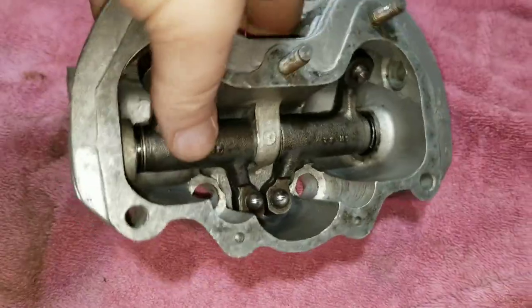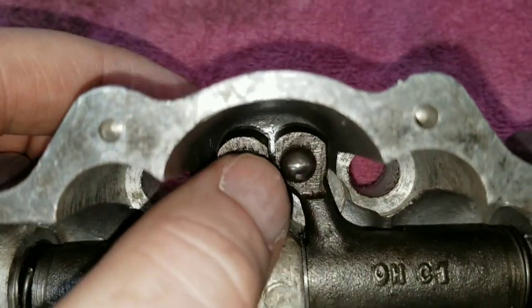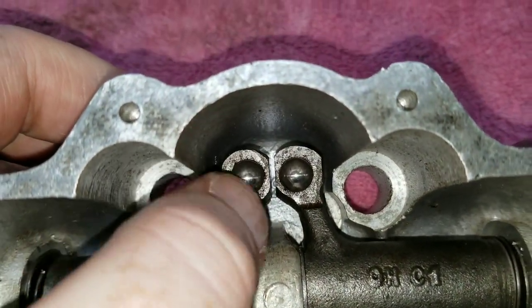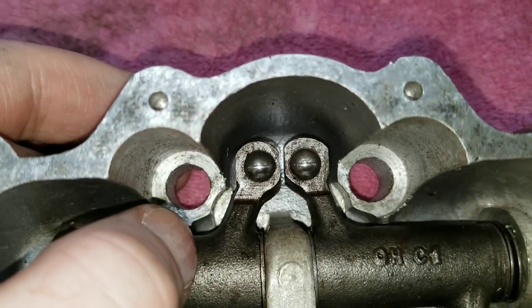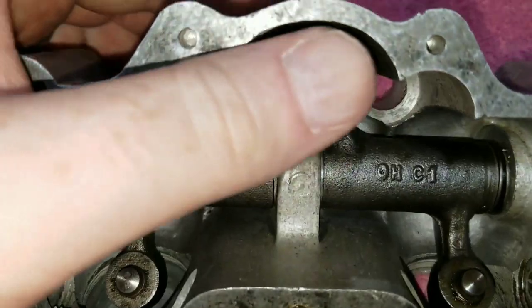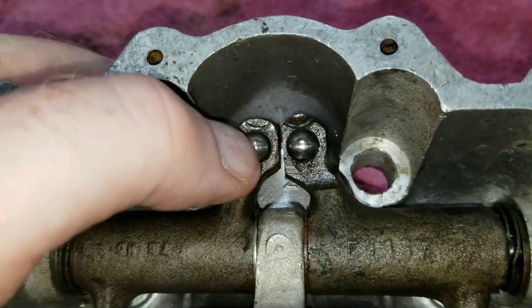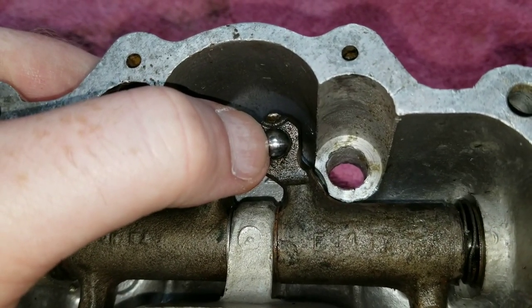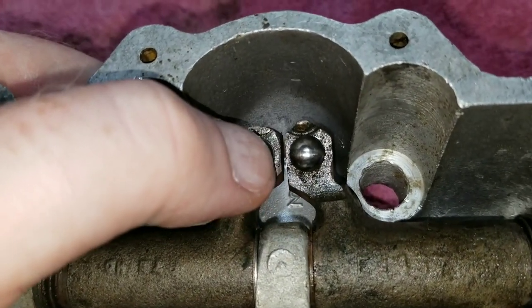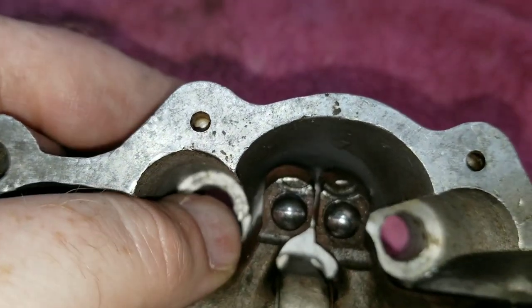This set we got didn't have any visible damage inside, and the parts where it tightens down to the head bolts are not cracked. The other one that came with this set had the same problem we had — the push rod was not engaged on the ball — but it didn't gouge the cover. So both of them are usable and they're not cracked like mine were.